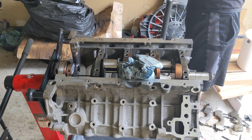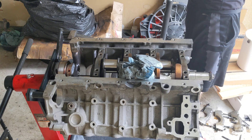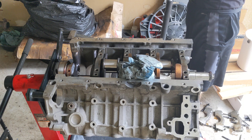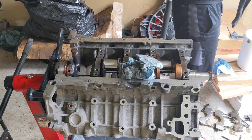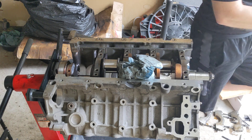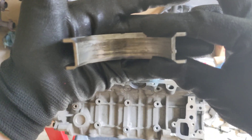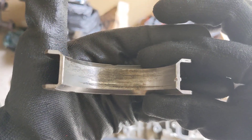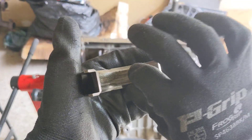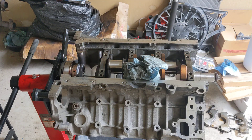Can I film this with my nail? Yeah, it's catching. We might have to stop for today because I might need some bearings. I'll show you guys — it's not looking good for this one. And I can feel that with my glove off — I can feel it about right there. My nail does catch. Thankfully, the crank is fine.